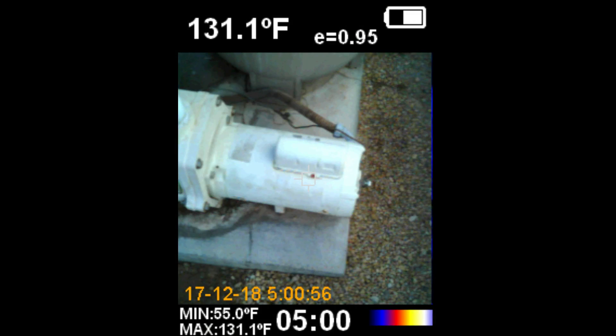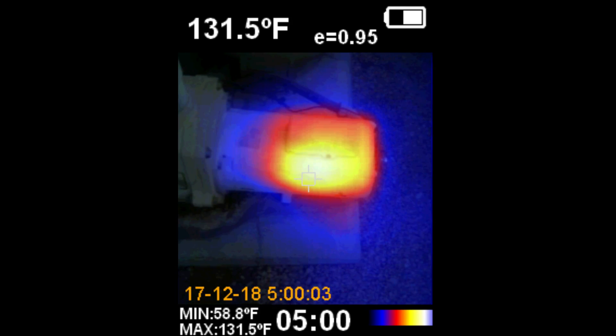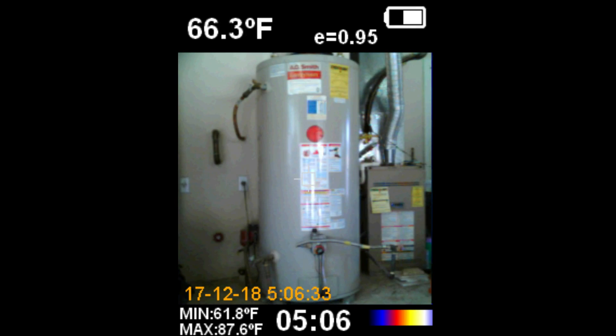In this image you can take a look at electric motors to look for hot spots in the windings. You can see the heat generated by the winding and the location of the winding. You would move the infrared imager around the entire motor to make sure everything is uniform.